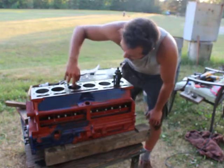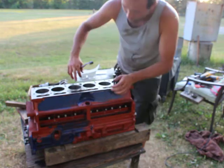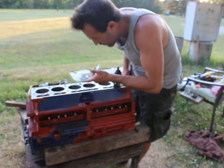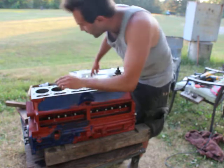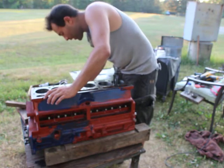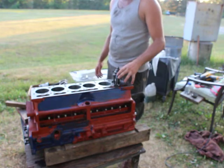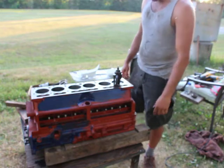It just seems to work much better — very smooth. I can barely tell the difference between the honed cylinder wall and the part that I ridge reamed. I've already taken off the ridge from these pistons and I'm going to leave the two in the middle with the ridges just to see what happens. I know it's against better judgment — you should technically remove the ridges — but there's not a lot of ridge, so I just want to see if there's going to be any problem. I actually got this tool from eBay, just arrived today, and I don't see how it could be any better.